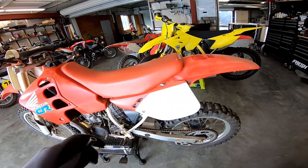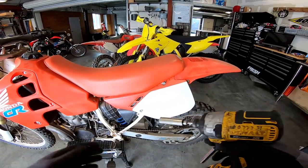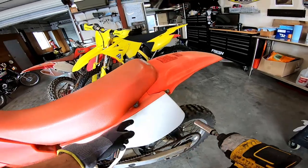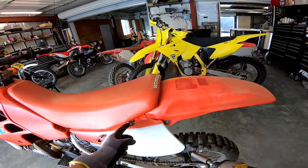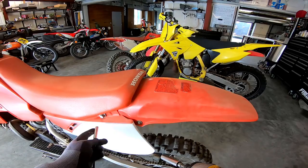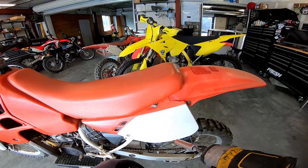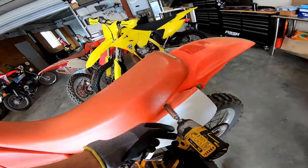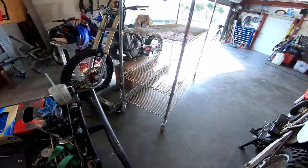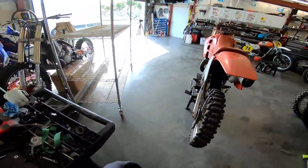When I start tearing into a bike I like to see what hardware is factory and what hardware is not. Most of the time with used bikes you end up with a bunch of random hardware. Already I can see that though this bike is in fantastic condition for its age, it has a 13 millimeter Ace Hardware Home Depot-looking sort of fastener here. They nailed it on the metric, but I don't think that's stock — something like this would be an 8 millimeter. Maybe somebody can chime in in the comments if you had one of these growing up — 1990 CR500. Experience tells me that's not the case, but that doesn't mean we can't get it off. Lock washer, flat washer — that's pretty unusual. So in the tray it goes. We won't be reusing that, but we already have spare parts on our CR500 build.